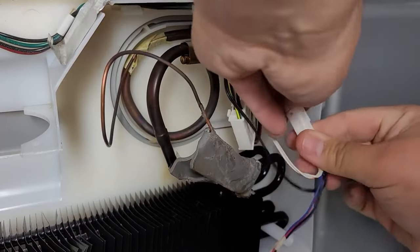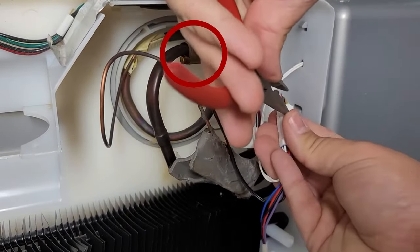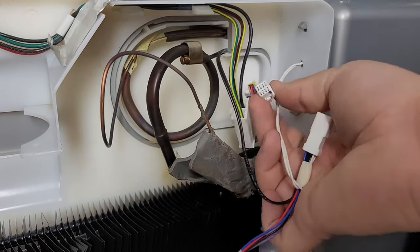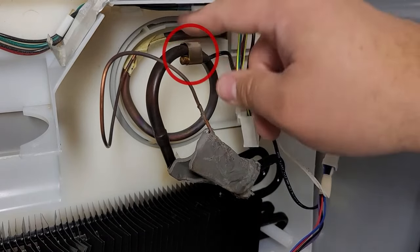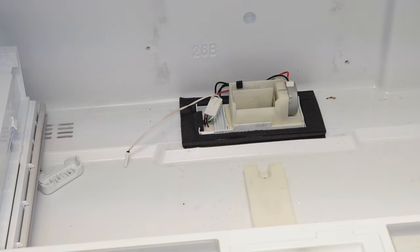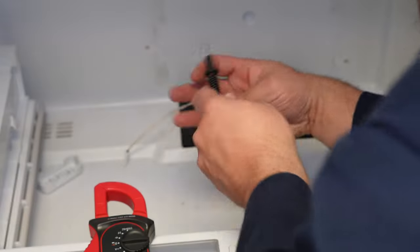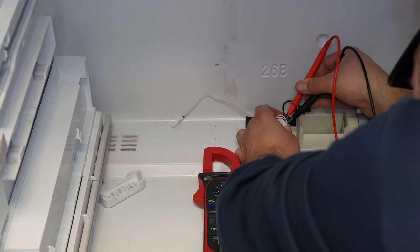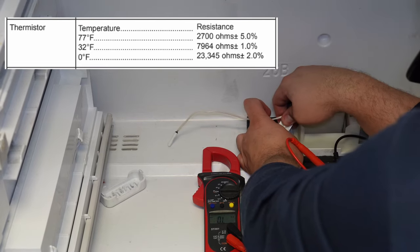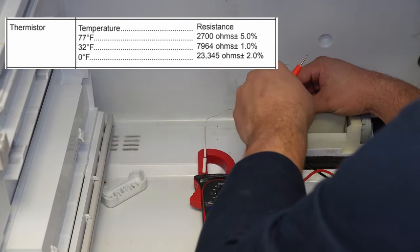On the dual evaporator style unit, if you had heavy ice buildup and your thermal sensor is located on top of the refrigerant loop, you'll want to replace the fan and thermistor system together as they are both known to go bad fairly often on this model. I have another video on how to take these apart and reinstall them with links to both parts in the description. You can also use a multimeter to test the thermistor by finding where the wires go into the sensor system and testing for resistance. The resistance values you should expect are the same on both single and dual evaporator systems, though the exact multimeter procedure varies from unit to unit.